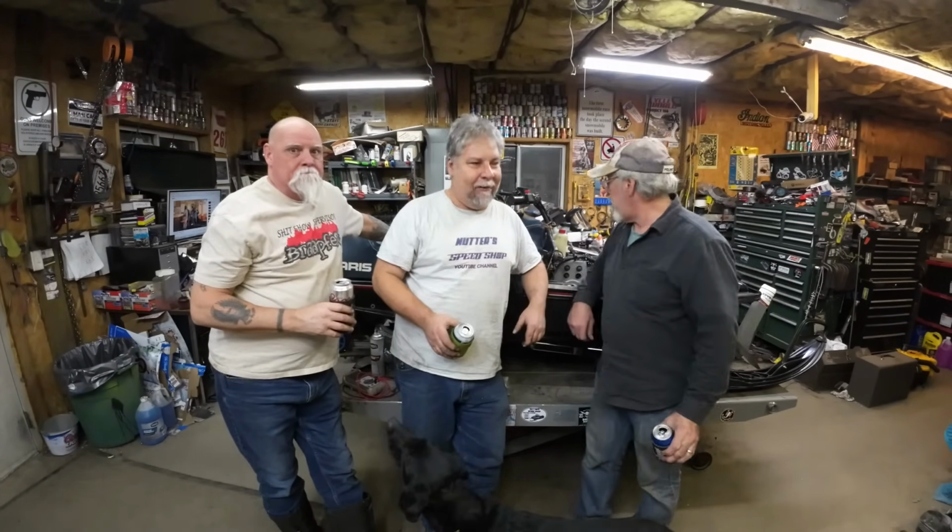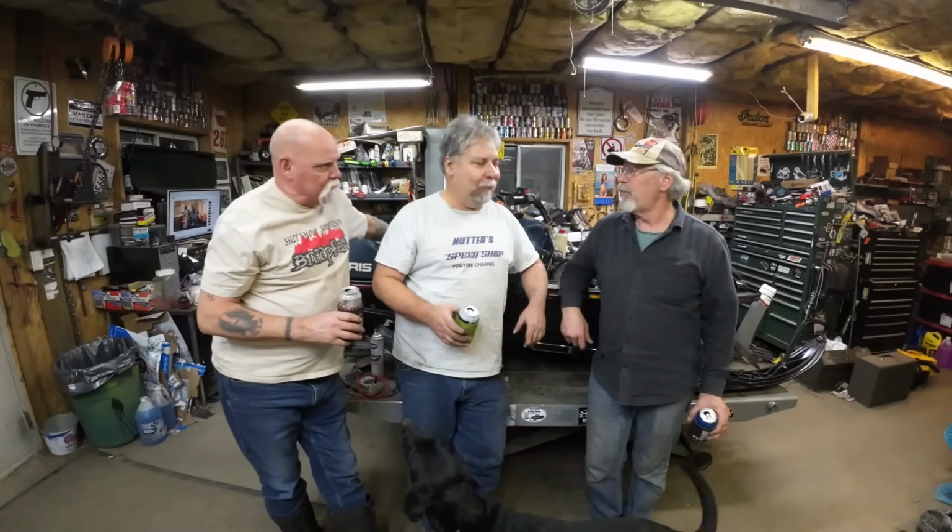There's tonight's shop night. Tommy got his chrome trailing arms and those fancy little chrome steering arms. I don't even know if I've seen those before. Most of my sleds have those. Do they? Well, I just never paid attention then. And the skis. Don't forget the skis. And the plastic skis. So Tommy got all that done. We did pull off one radius rod, took it over to the press and straightened it out. It's straight enough. I took the radius out of the radius rod.